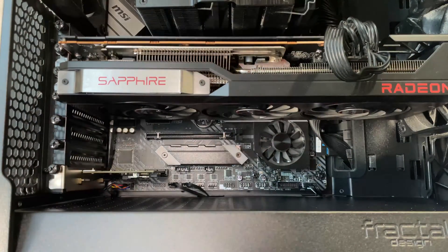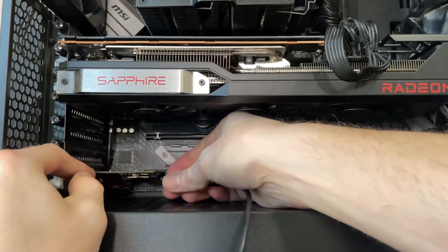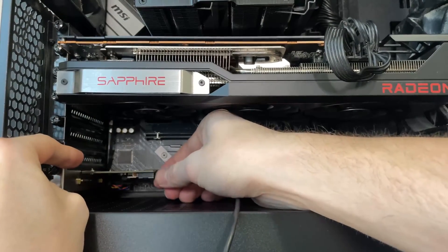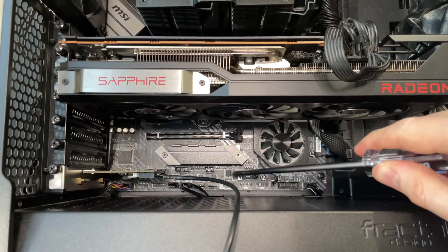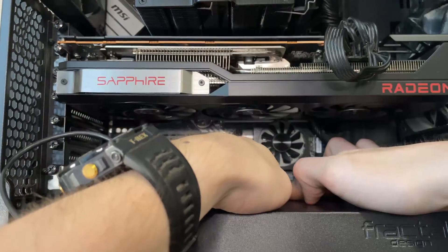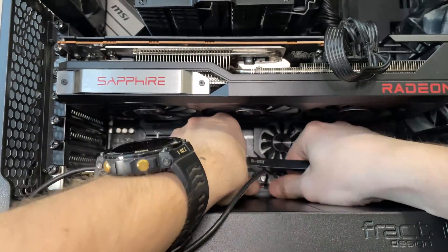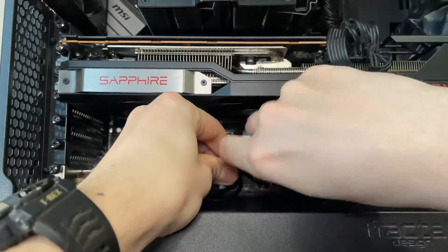If you don't need Bluetooth you can stop here, but it would be a shame not to take advantage of it. So properly insert the provided cable on the side of the Wi-Fi 7 adapter, and then as the manual says, find a USB 2.0 connector on the motherboard. If you're in doubt about which ones are suitable, look for connectors with the same pattern as on the cable — you'll also usually see the USB header label written on the motherboard near them. Insert the cable and tuck it however best you can — I did a terrible job at it.